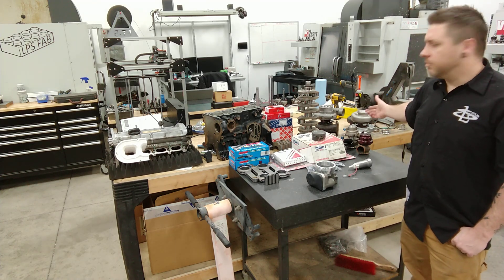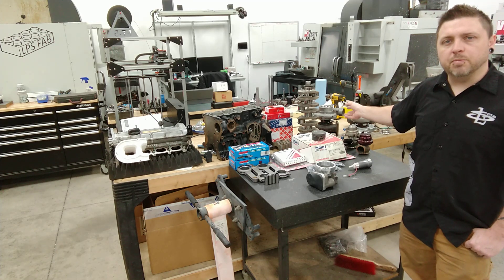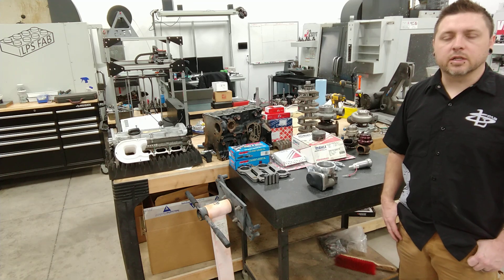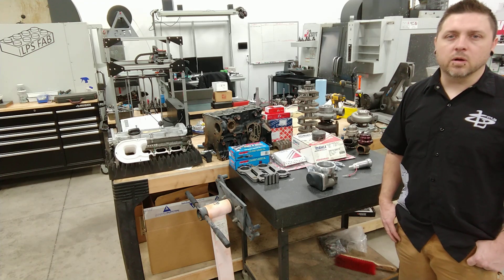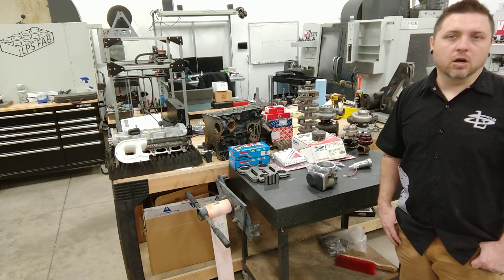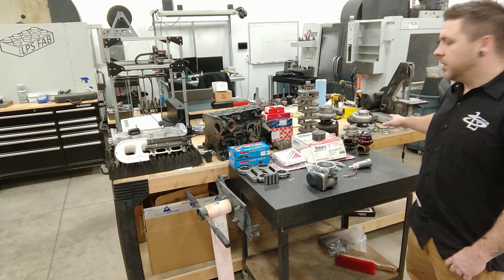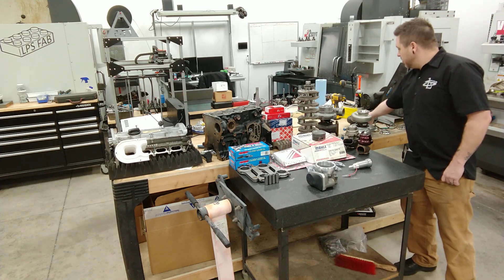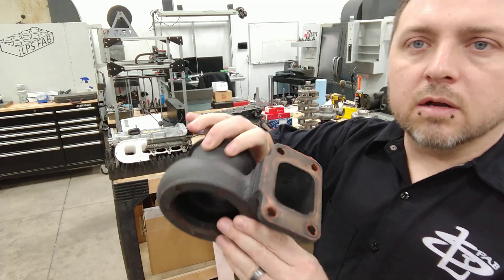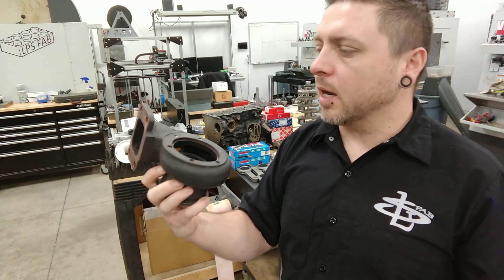A couple of turbos I have here: a 35R and a 3071R, both of which need work. I think the 35R is probably too big for the application because I am planning on running a TDI transmission so I can get really high gears and really good gas mileage. I've had a TDI transmission in one of my Volkswagens before and I absolutely loved it — it was a highway monster, like 2,800 RPMs at 90 miles an hour. The 3071's exhaust housing has all these broken-off bolts in it, and it's a .63 housing, and I don't like small housings — I like to get rid of as much back pressure as possible.